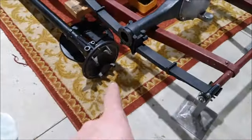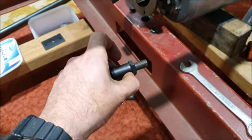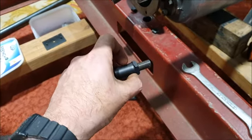Just figuring out where to start. I've been doing lots of little bits and pieces again today. The gearbox, as I mentioned before, the universal is all done now. And I also welded up the nut to the central mounting point for the gearbox, and then just gave it a coat of paint. I TIG welded it in the end. I had just enough gas left to do it, and then I just machined the weld just to tidy it up. And that's just to lock that nut onto there.